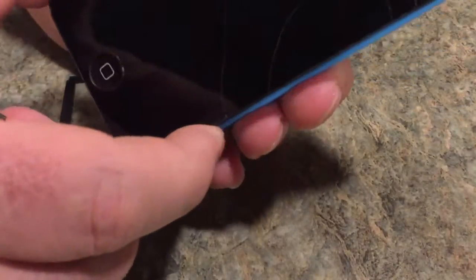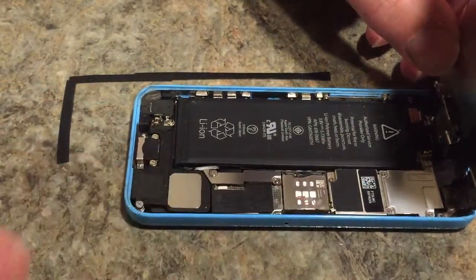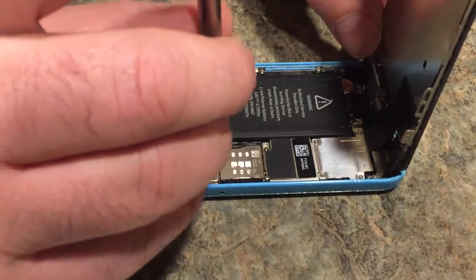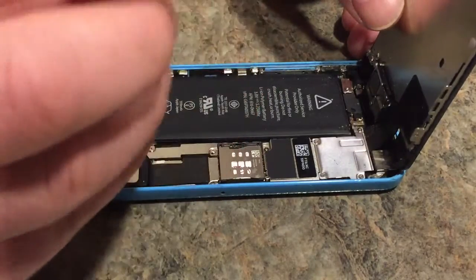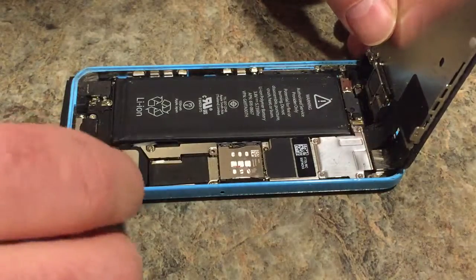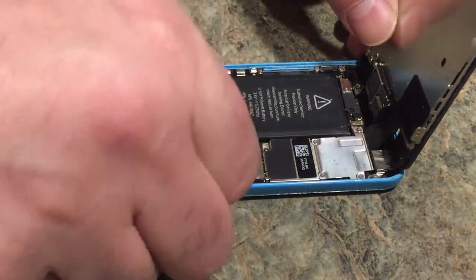The thing here is you can't turn the LCD off, so what I'm going to do is disconnect the battery. To do so we have to pop up these two clips right here to get to the metal frame. There's one screw there and here's a second one. I'm taking precautionary steps - if you can turn yours off, that would be the best thing to do, but I still recommend disconnecting the battery.